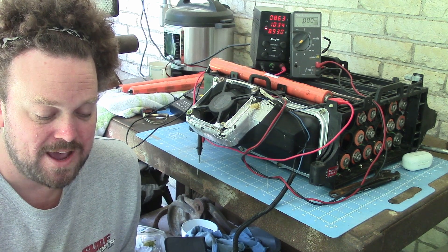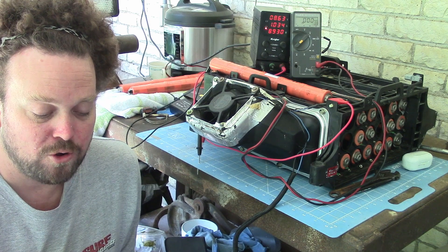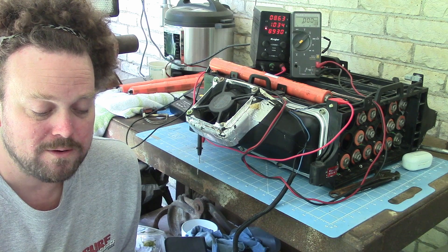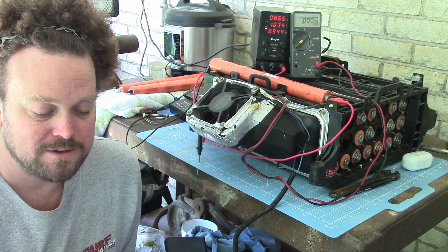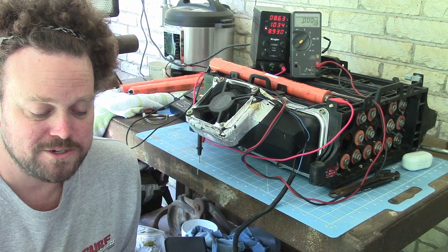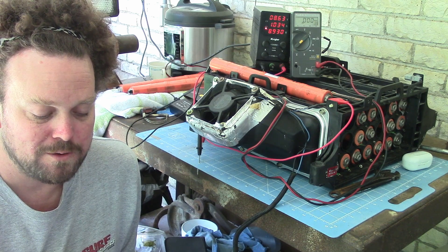And this condition damages the cell by screwing its electrolyte. This is exactly what happens when a battery of dissimilar cells — i.e., an old tired IMA pack — is discharged to zero. Weaker cells drop to zero faster than stronger ones, and stronger cells then push reversing current through the weaker ones, damaging them. So the result is further damage to those cells that are already weak.